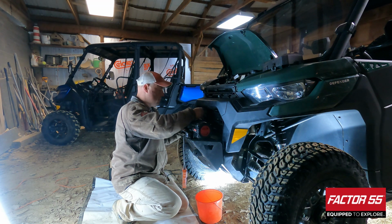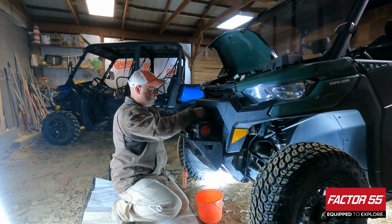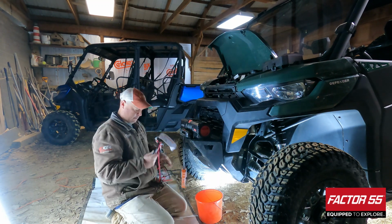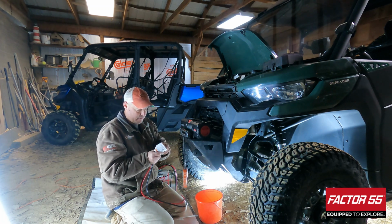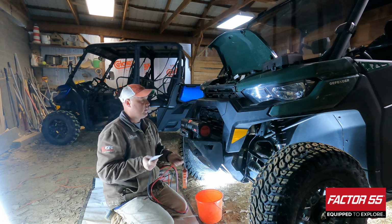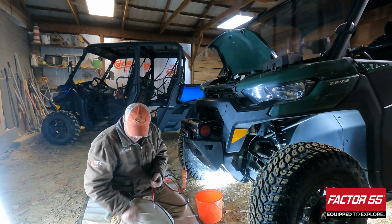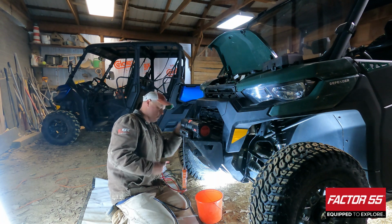Okay, so what is on here is there's a red dot on the positive side, which is the bottom one. Now, nice part about the Axon winch, it does not have that solenoid. All it has is a positive and a negative on the 5500, at least, just like the winch on my Jeep. So I just got to go to the positive negative power source or the battery, which on this has a post up under the hood, and I will be good. So now I have to make sure I have the right size wrench for these little nuts that go on the back side of that.